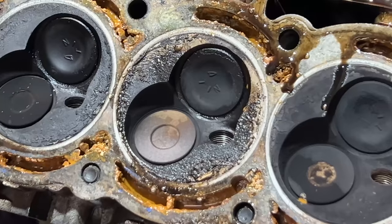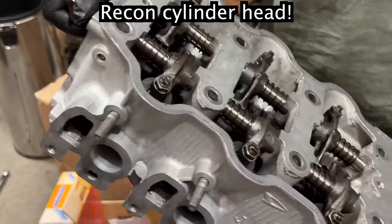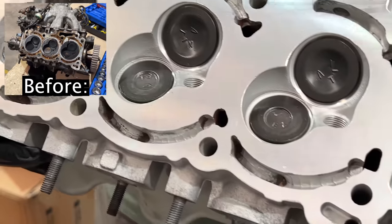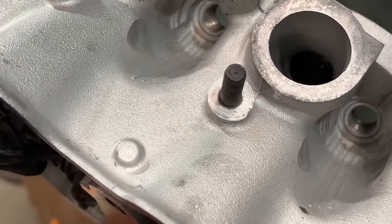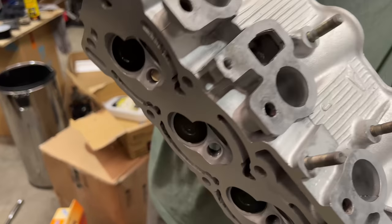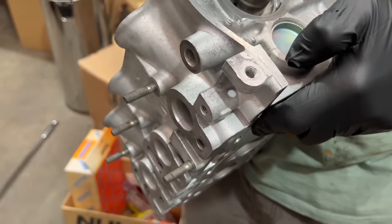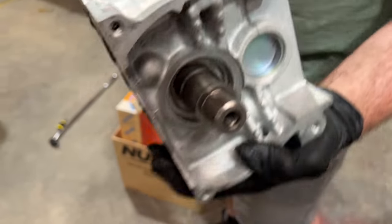Come and have a look at some of the new bits. Here's the look of the head when I had it pulled off — and here's how it looks now. This is the same part — this is how it's meant to look. The Daihatsu branding in there. Apparently the water jackets were really messed up and they had to weld some of it back together. Wherever they welded it, they did an excellent job. Amazingly, the cam and lifters were dead, gone — and they had one spare they were going to throw out. We got in just in the nick of time.